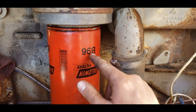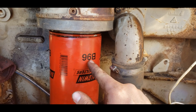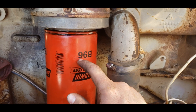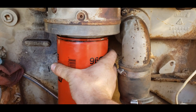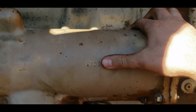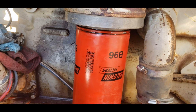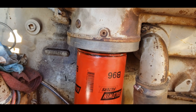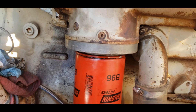A lot of people might throw a fit, so I'll explain: I reused the old oil filter. I pre-filled it with some oil — probably 15W40 — and the reason is that if there are any large chunks in this engine, I want the old filter to absorb them. If everything's not leaking I'll put a new filter on. Also, if it is leaking coolant into the oil, the last thing I want is to ruin a brand new filter. The old one will serve for testing purposes just fine — same reason for running straight water, just to verify whether it's leaking.